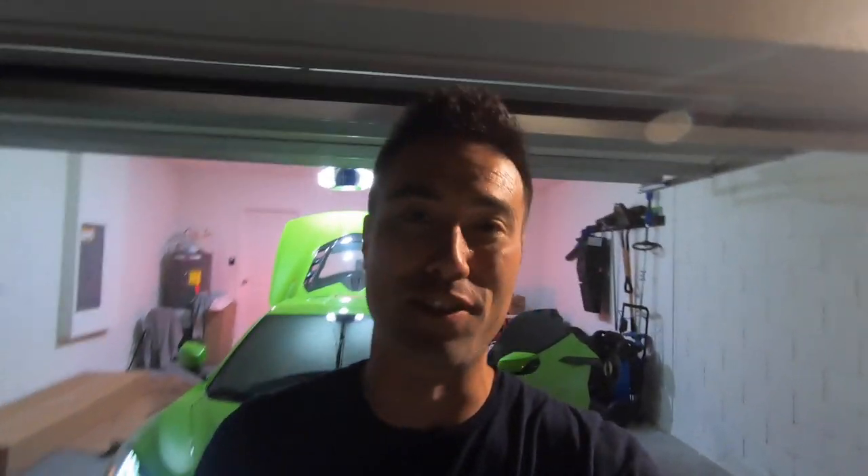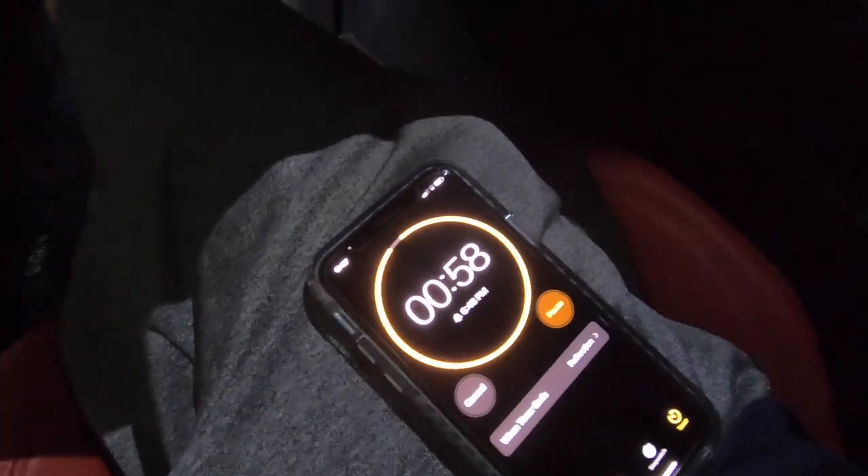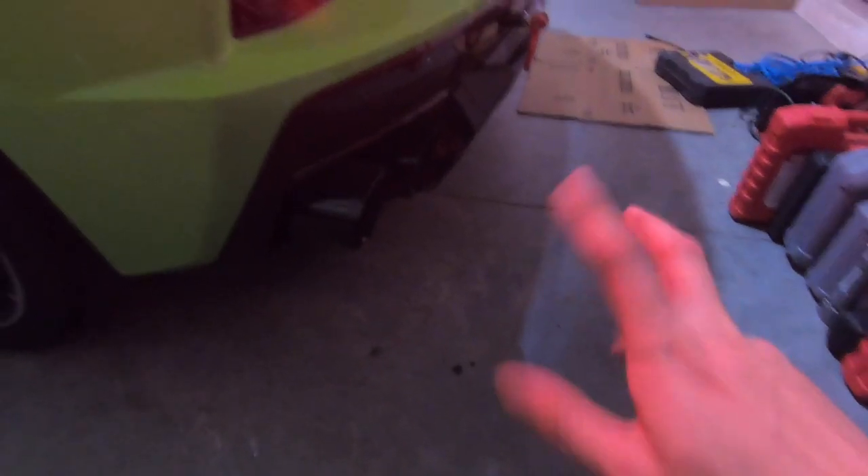Solar Performance also said it's going to take a little while to break in for the computer to learn everything. That's actually perfect because we're going this weekend to Homestead for a track day — when we get back we'll head up to the drag strip and see if the throttle body makes any difference. Shut her down, let it cool off for about a minute, then start again. The second time starting up for three minutes, it's got a nice deep low rumble — it even sounds a little lopier.